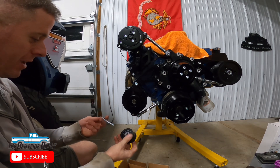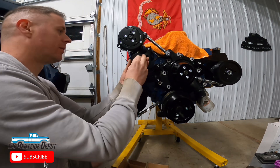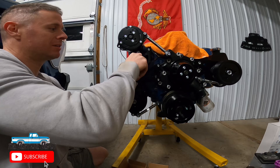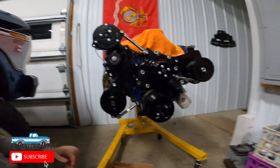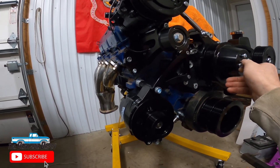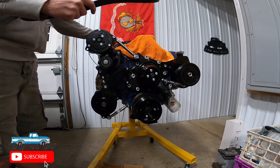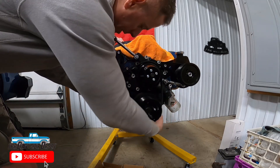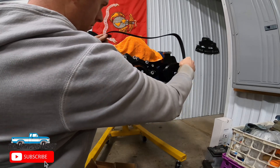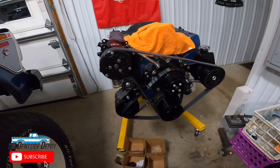And to prove I didn't mock any of this up beforehand, I just realized I accidentally put the idler pulley on backwards because I was looking at it quickly — it doesn't really line up the AC compressor. But that's two seconds to fix anyway. Now that is corrected, and that concludes getting all the pulleys on — of course they're sitting on loosely still. Let's get a couple belts on here and see what it looks like because I'm excited. We've got nice big serpentine belts here, which is way nicer than the old style belts that seem to always squeak. And there you go — that's it. That is the full install. Everything is on.